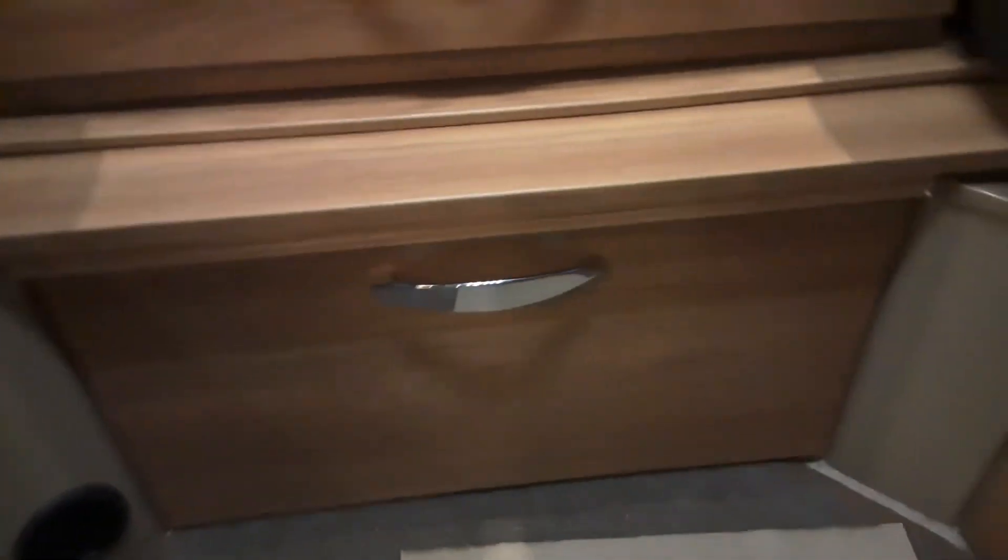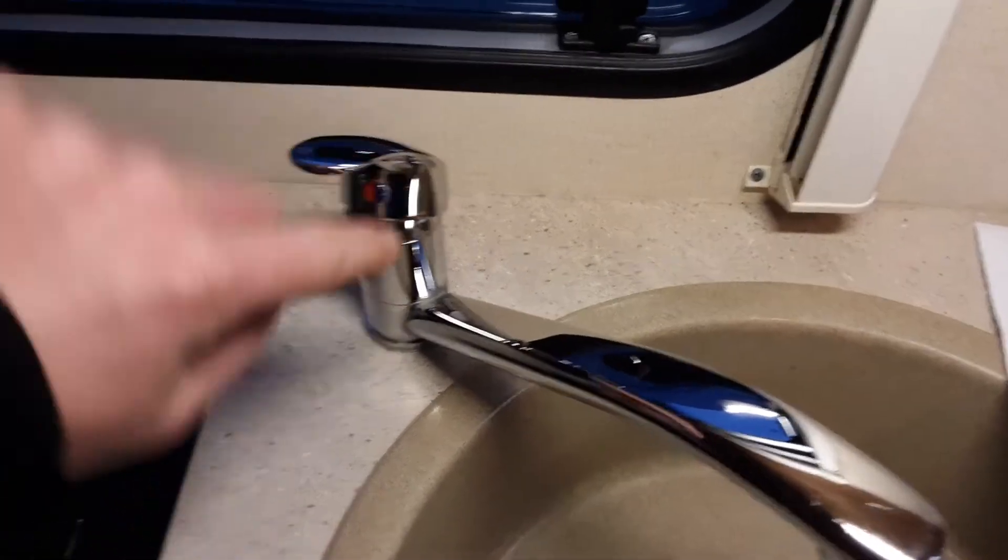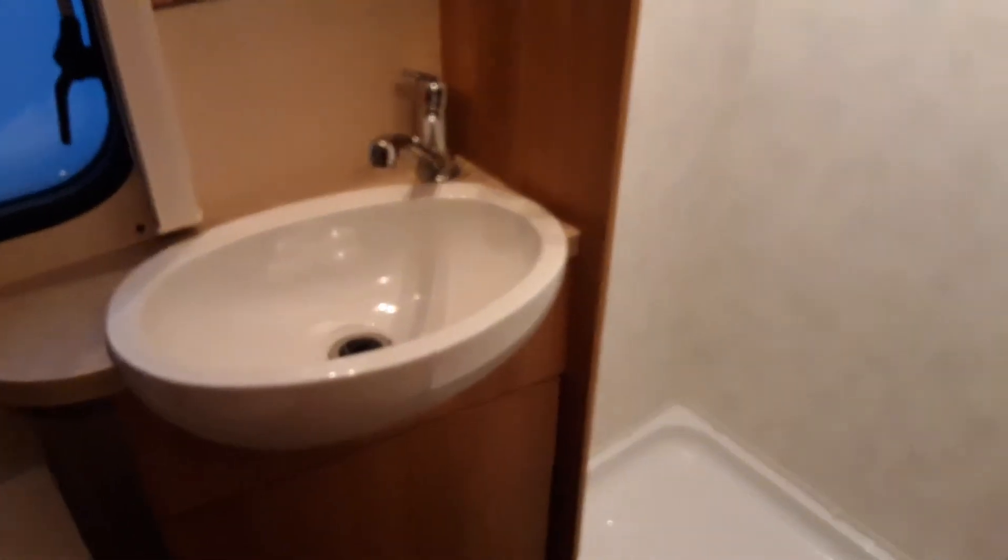Once that valve is parallel and you've got water connected on the outside of the van, come over to each tap on the caravan and turn the tap to the hot side of the water heating - the red on the tap - the same with the one in the bathroom on the sink and the shower as well, so they all need to be turned to the hot side. At that point, with the valve open underneath the seat, you can turn on the water pump. The water pump will now start drawing water from the onboard water tank or from the aquaroll on the outside of the van, up to the onboard tank inside. Once the water system is full you'll get water running continuously from each tap, then you can turn off each tap. To start with it will spit and splatter, just like when the water's been turned off at home - it's just getting the air out of the system.